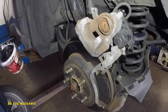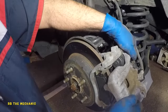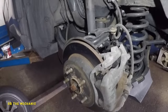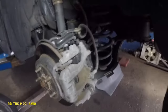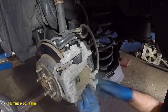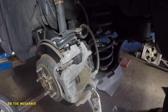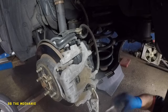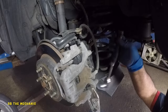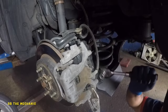This is a crusted piston, so put some greasing on it too. Be careful when you buy a car — get it checked out, because a mechanic won't see this without dismantling everything. Everything is done. Take the 14 millimeter and lock this bolt up — you'll probably have to hold it again with the vise-grip. After this, put your wheels on, start it up, and put the parking brake on a few times — it should calibrate and engage and disengage. Don't forget to put the connector back in.